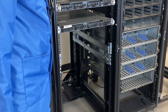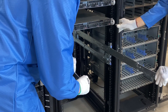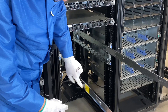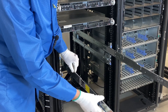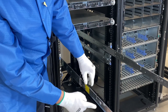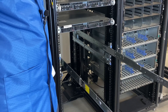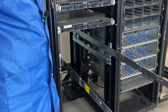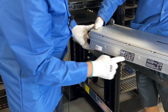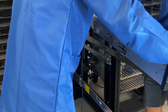So now we're actually going to put our R730 into the rack. This is relatively simple — we're just going to pull the rails out. You will notice that there are several pieces within the rail that click into place. This tab right here will actually come out — there are your inner rails within the outer rails. You'll notice there are some cutouts, and that's where we're going to be putting rivets in. There are four rivets here. If you look at the side of the R730, you can see the four rivets — those are how you're going to line this up with your rails.